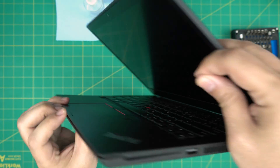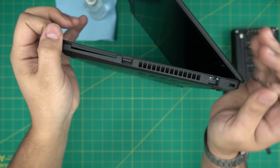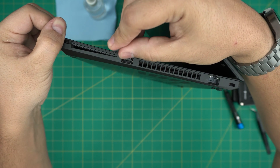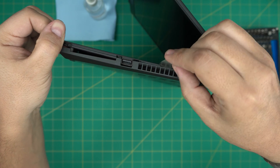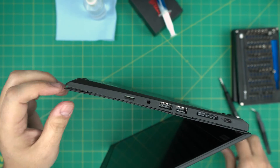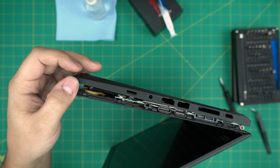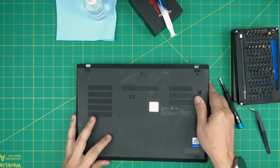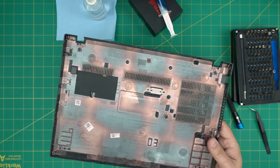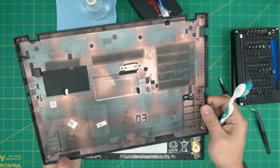Once the front is open, go to one side. If putting tension in the wrong spot could crack the cover, place the opening tool carefully, push it up, then work your way out to the back corner. Do the same on the other side. Now close it slightly, grab the bottom cover, and bring it up to remove it. Another important tool is a toothbrush — use it to clean the dust mesh on the bottom grill, blow some air through it, and that takes care of the bottom grill.